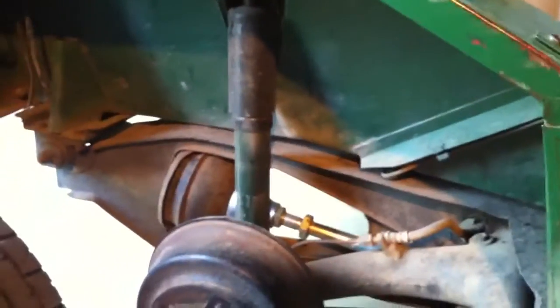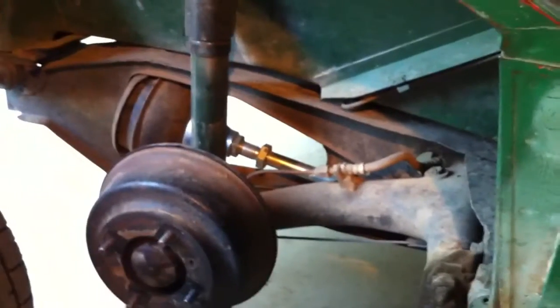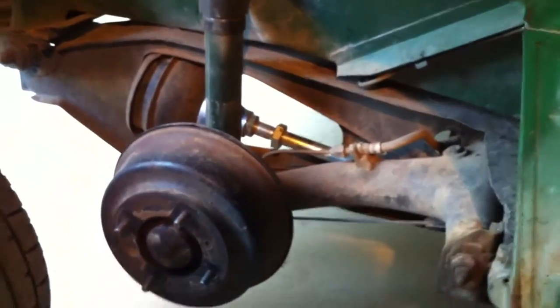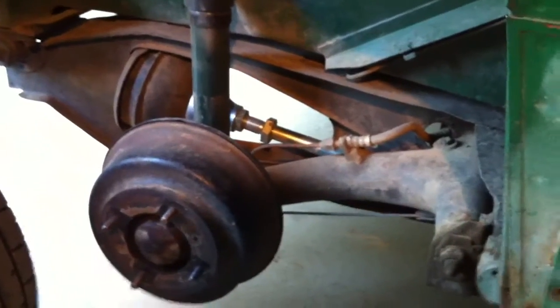This one here I installed a hi-lo setup, but you can still see that you can easily rotate the spring — it's fully unloaded. Of course, the hi-lo is locked to a position here with this jam nut setting the ride height. I set this up so that when it's jacked up, the length of the shock somewhat loosens the spring but doesn't let it sag down or risk any parts falling out. I also tell people these are fairly easy to work on if you want to change the spring or service it.